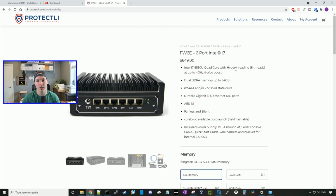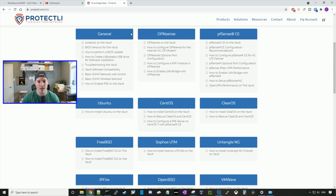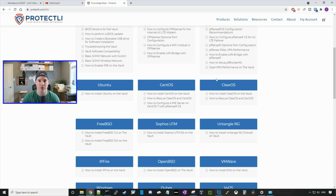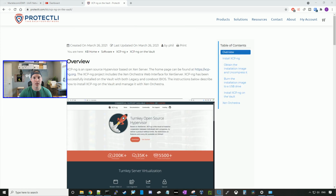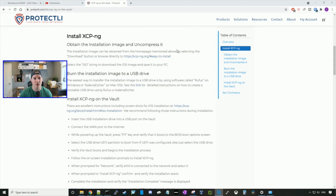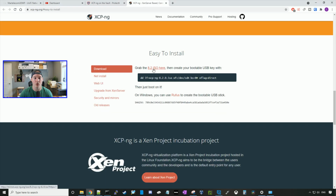So the first thing we need to do, we need to get the XCP-NG ISO onto a USB. We could go over to resources and the knowledge base. Under the knowledge base, you can see all the different operating systems or appliances that you could run on the Protectli box, but we're just going to focus on XCP-NG. On this page, it gives you an overview of XCP-NG and Xen server. To find the image, we do have this install link and I'll put it in the description below. And then we could grab the ISO here.